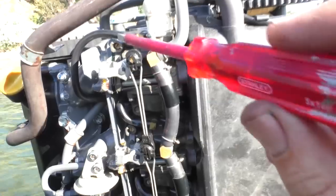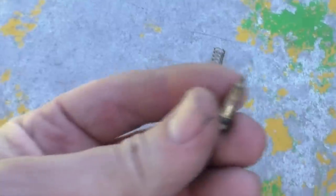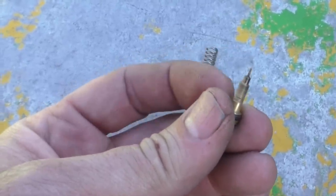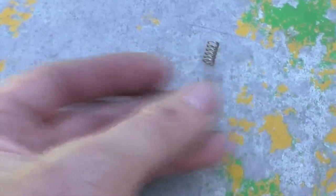The other way we know is by the shape of them. The screw's got a spring that goes over it and then an O-ring at the very end, but the important thing is that it's a real needle screw. Because it comes to a really fine tapered point, that's also what tells us this is a fuel mixture screw.